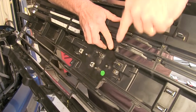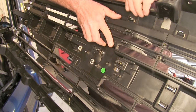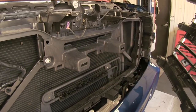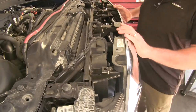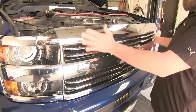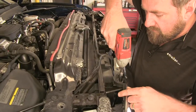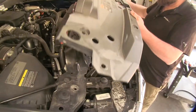Now we're going to reinstall our factory grill. On the back side of the grill you can see it has metal clips that are going to snap in to the fascia of the vehicle. They are slotted so we can adjust it to center and make sure our grill is nice and centered on our truck. Once we get our grill down into place and lined up, it'll snap into position. Then we can replace our four 10 millimeter screws along the top and we'll be ready to put our filler panel back into place.